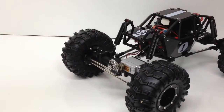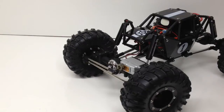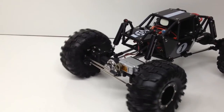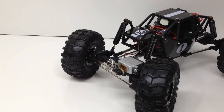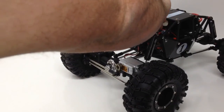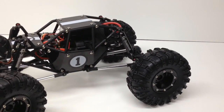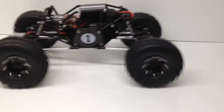Let's do a quick little test of this thing. Just want to show you some of the steering — the steering is just ridiculous on this thing. I have full travel right now on my steering, turned all the way up to about 150%, so it's definitely getting some really wide steering. Pretty good speed right there with the 1283 — not really meant for speed, but it does have over 400 inch-ounces of torque. As far as the throttle, let me go ahead and click it on. The BEC you see is kicking in. Got a delayed reverse — I need to slow the reverse down a little bit through the hotwire.